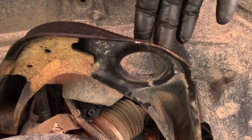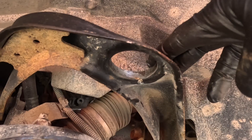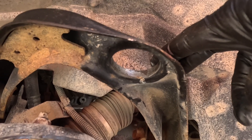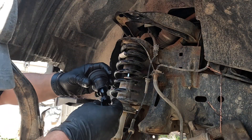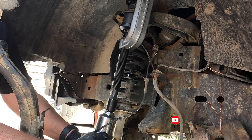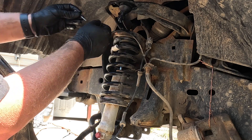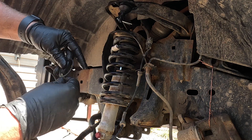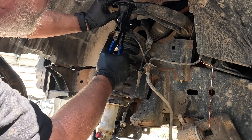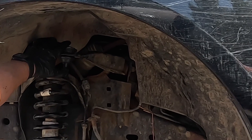I gave it a quick sand inside to clean out any debris and rust, then cleaned it with brake cleaner. I'm going to put a little bit of anti-seize in there to make it insert a little easier and prevent rust. Time to reverse this process — here goes the new one. Just putting that in there temporarily and getting the C-clip in. That is in and done — that ain't going nowhere. I've got the driver's side upper ball joint replaced. I'm going to do the other one off camera, same with the other brakes — no point watching those twice.